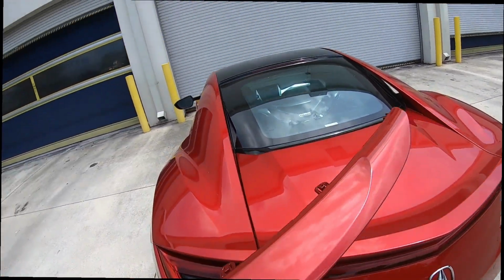All right, so there you have it. A trim piece that received our red base, red tinted clear, and then two coats of regular clear. Now in the factory, they might take that step a little bit further. I'm not sure exactly of the paint processes. But as far as I'm concerned, this is a recommended way to refinish any panel utilizing this paint code R556B.